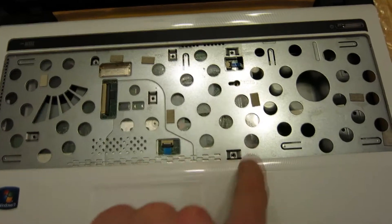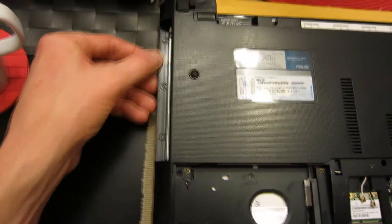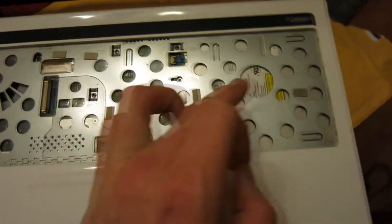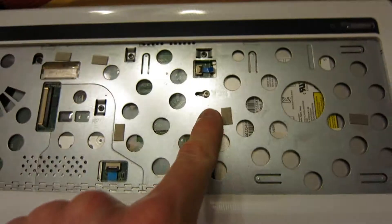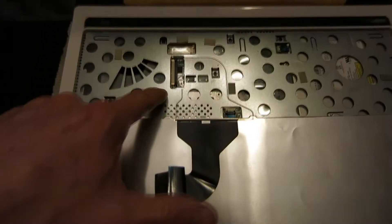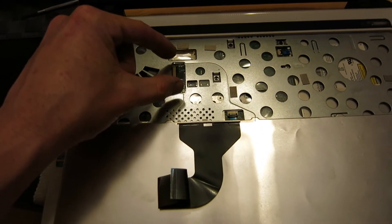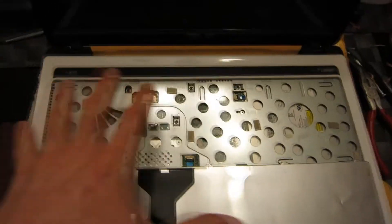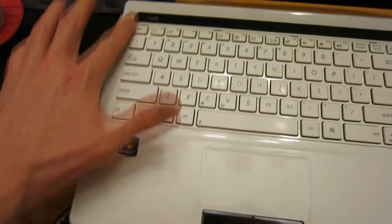The screws go: one, two, three, four, five, six — looks like seven. Then we flip it around, and right here where the hard drive and CD-ROM would be, you put in one, two, three screws — those are the tiny tiny ones. One of the seven screws is going to be a silver one right here. Slip your CD-ROM drive back in and it's going to lock up right on this little hole — use the silver screw and tighten that up. So that's six black screws and one silver screw makes seven. Now reattach the ribbon for the keyboard in this slot — slip your ribbon back in and lock it down nice and tight. It slides from west to east and locks back down east to west. Put our ribbon back in and then snap the keyboard back into place, making sure the tabs lock here, here, here, here, and here — nice and flush, completely like brand new, flat and level all the way around.